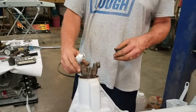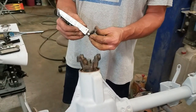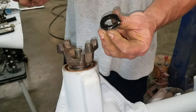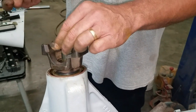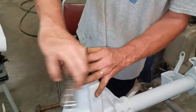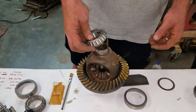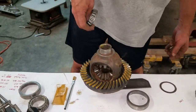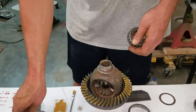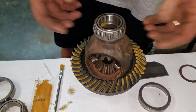I went ahead and pulled my pinion back down — this is the final assembly. Like we did with the Dana 20, we're going to put a heavy bead of RTV around the base of this washer, and that'll help seal these splines. I'm going to go ahead and press on my bearings for the final time. You can see how the setup bearings just sort of come on and off — now I've got my shims there, I didn't have to change anything, so I'm just going to press the final bearings on.